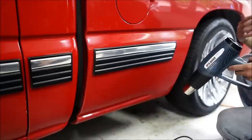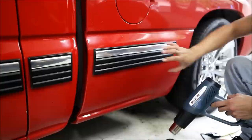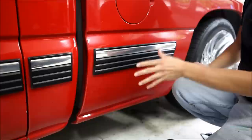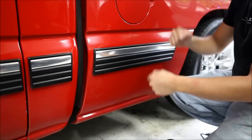Dallas is going to finish up while I apply a little bit of heat to keep it lukewarm — that makes it easier for the fishing line to cut through. What you're going to watch is Dallas coming across with the fishing line to separate the adhesive from the molding. Don't get any ideas thinking you'll just heat it up and tear it off — I've seen it happen where because you're really pulling and it's not warm enough, it actually pulls some paint and clear coat off. That's why we're taking the fishing line through to separate it first. Dallas is going to angle toward the molding so he's not digging into the paint, since there is dirt behind there.